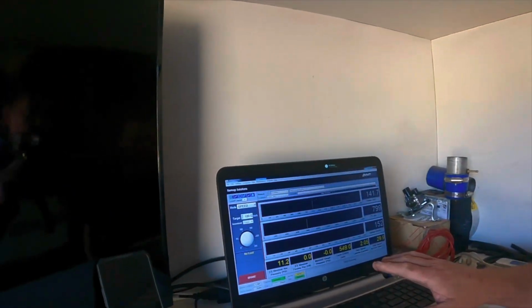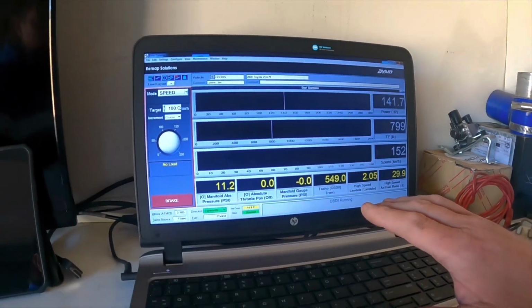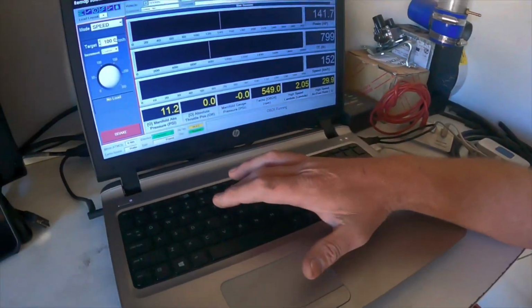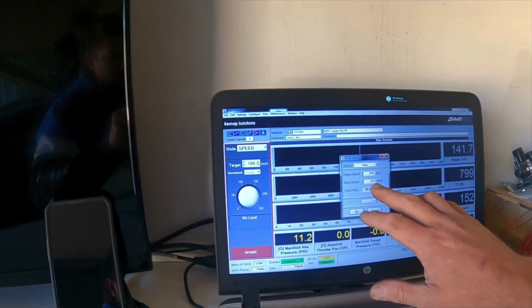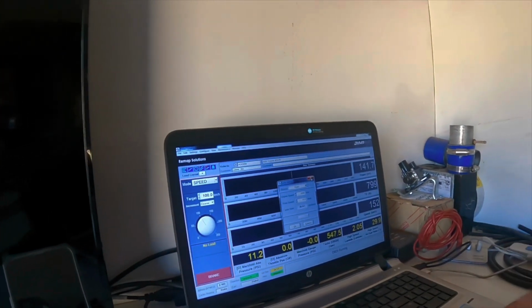Yeah, good morning lads, how are you? This screen here is what we call our speed screen. We set what we call a tacho ratio. That gives us our start and finish speeds for the dyno. Now that is 2000 RPM is measured here, and then we set our speed up and it's 75 kilometres an hour, fourth gear, and that'll give us our tacho ratio for our start and finish speeds for our graph screen over here.